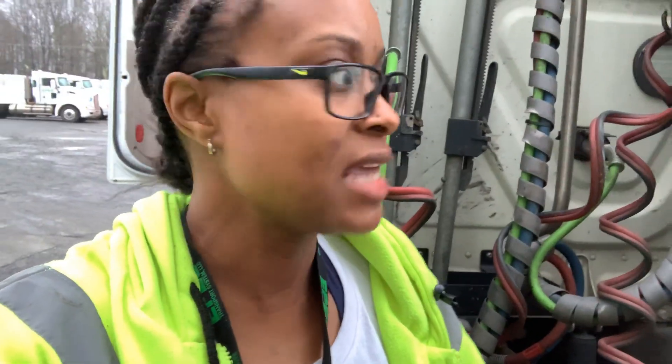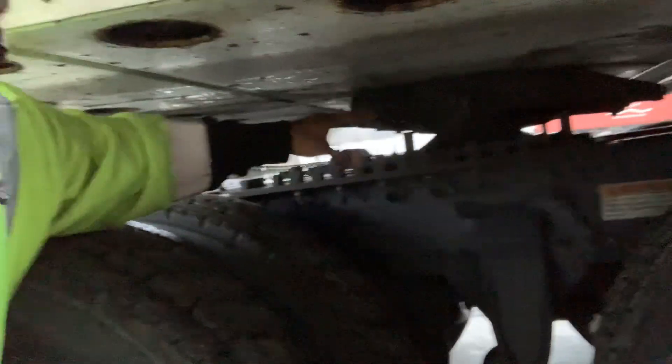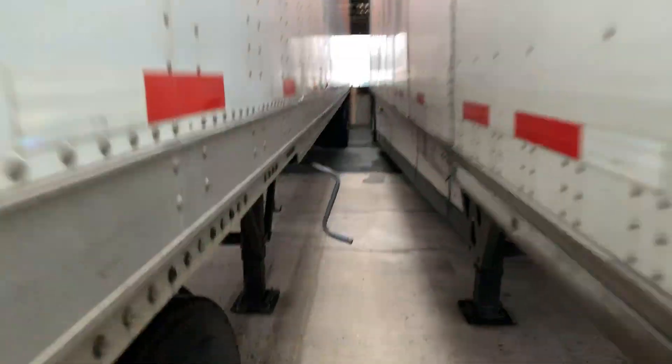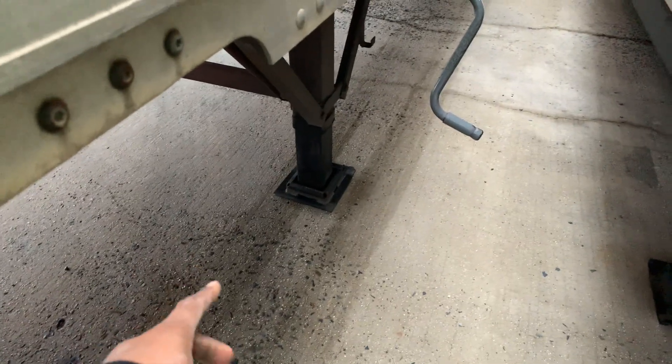What I forgot to do — and I'm sure a lot of people probably forget — well, you can't forget to pull the fifth wheel kingpin because you ain't gonna get loose. I think the main thing most people don't forget is to pull the kingpin lock. This kingpin handle right here unlocks your fifth wheel to the shank. But the two common things most people forget, which can cause problems, is remembering to put your landing gear legs down or up.